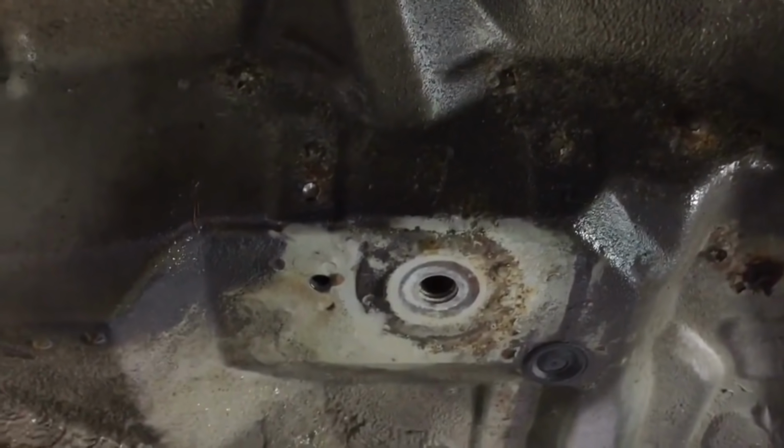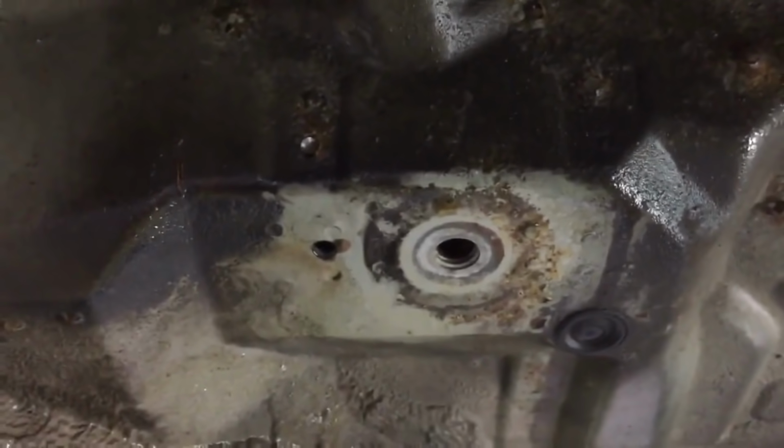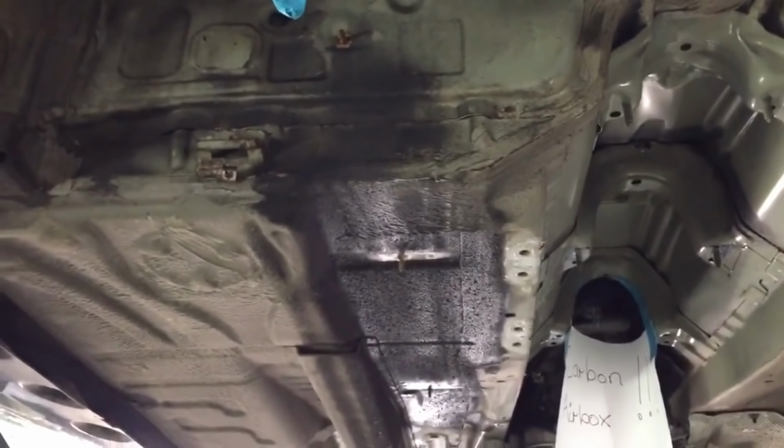And then left rear, which has got the common crack on the fold there. A little bit of spot weld movement by the looks of things, and a bit of corrosion which again needs attending to. A little bit of a sealer split here on the side lip, so we definitely know the floor has moved or is moving. So that's the reinforcement work that will be happening. And then obviously we've got all the scrubbing and cleaning.